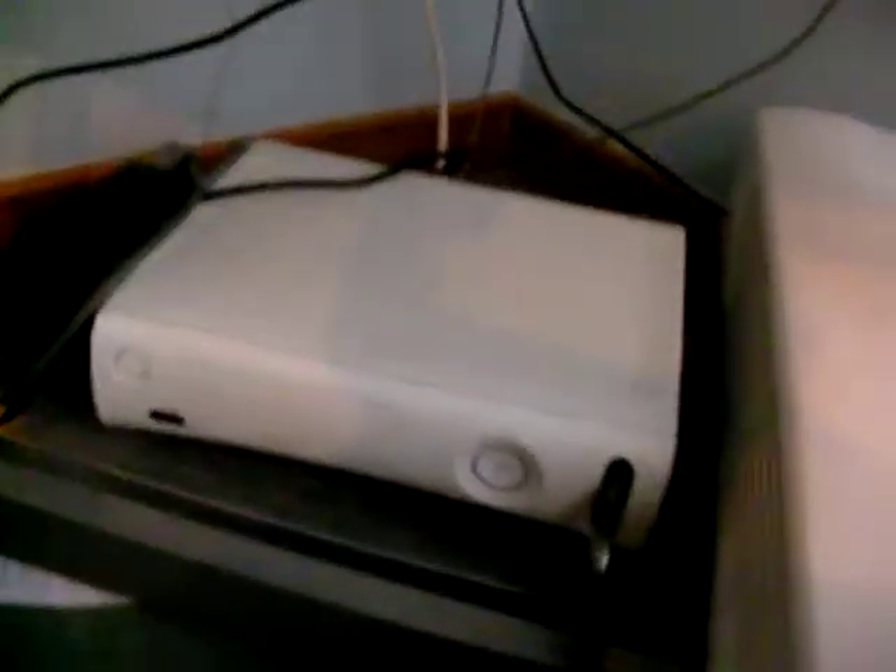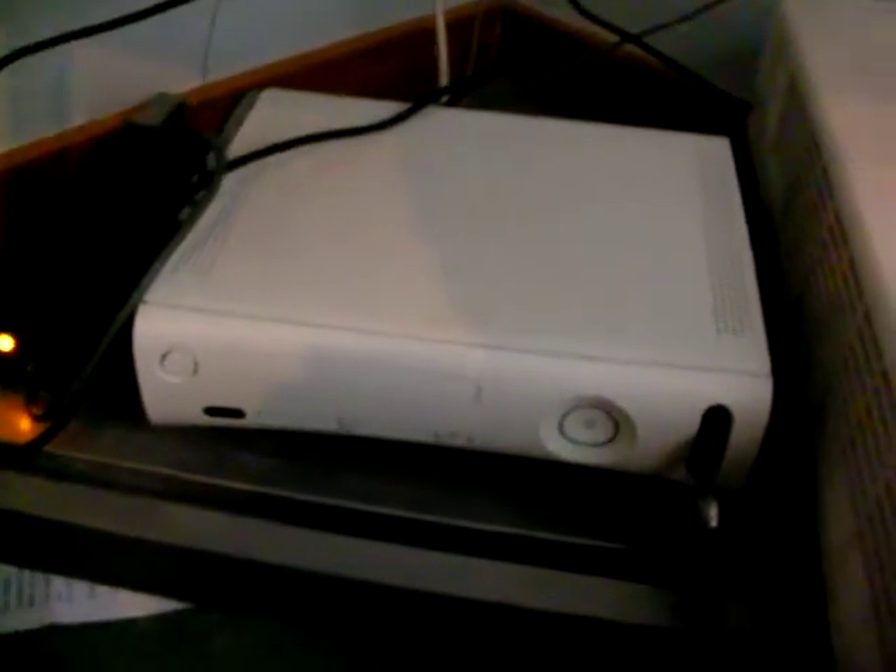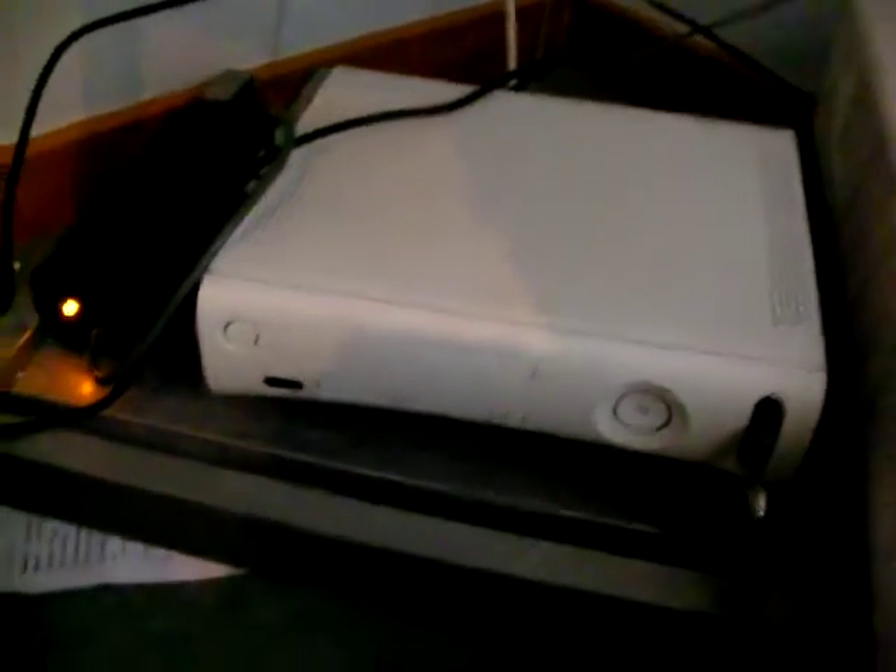Here is my simple technique to cool down my Xbox 360. A lot of people end up getting RRODs, same as I did at the start of this year. What the RROD is, is that the CPU or GPU heatsink basically wasn't efficient enough to cool the Xbox 360 down from the fan. The solder kept expanding and cooling due to rapid heating and cooling, and that's what basically damaged it — the GPU or CPU processor could not take it.